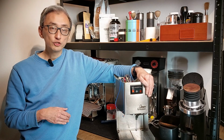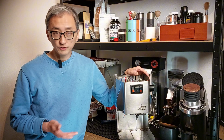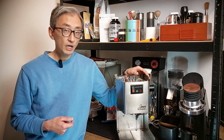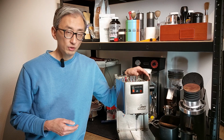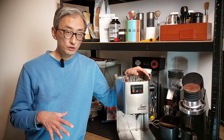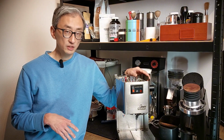Another option is to buy a filter like ZeroWater. ZeroWater, to my knowledge, is the only one that really works. Those regular kitchen filters remove chlorine, odor, and particles, but not minerals. I also tested Brita, which is very popular, but it removed only around 25% of the dissolved solids in my water. And here the water is around 250 ppm, so it wasn't good enough. But ZeroWater removes 100% of the minerals.